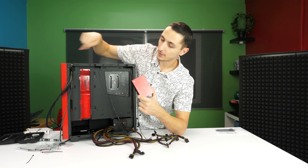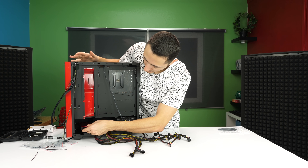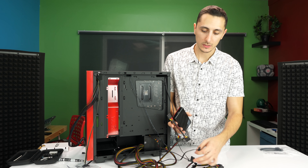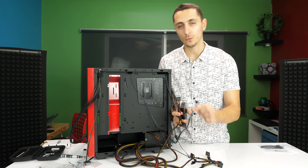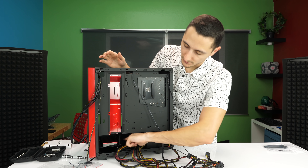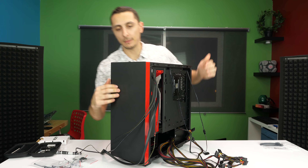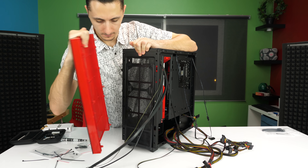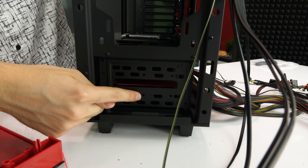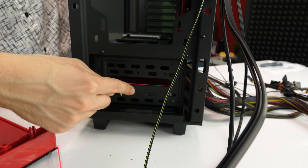The hard drive gets installed on the back of your case. Flip it around with the sticker facing the top and the connection facing outwards, then slide it into this portion right here. The hard drives are really wide so they slide in easily. It uses the exact same connections as the SSD — one SATA cable and one power cable — both plugged in the back. Slide it in and screw it from the sides; there's a screw hole on each side. You can access the other side by popping off the panel, removing the dust shield, and you'll see the screw hole there to align with the hard drive.